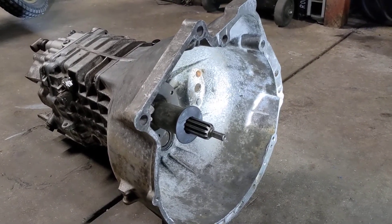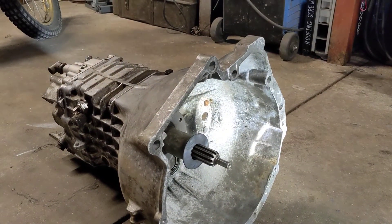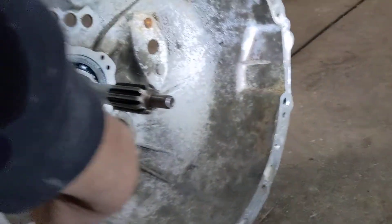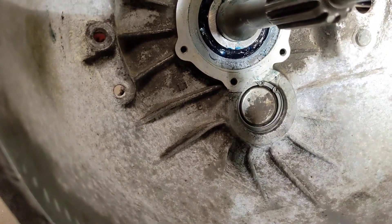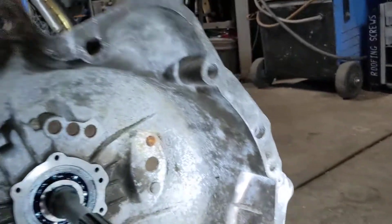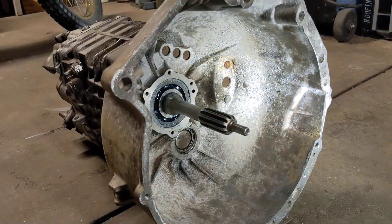I found that write-up lacking in some details. Pretty much just put your puller on and pull it apart — it should split easily. When knocking it back together I had trouble, which is why there's a notch in the puller. When pushing it back together, there's a bearing race for another shaft that comes in here. I mistakenly took that circlip out — don't do that. When I bolted it back together I ended up forcing it and started pushing the bearing race out, so I had to pull the whole gearbox apart again, knock it out, and reinstall it from the inside. As long as you don't force anything you should be fine.